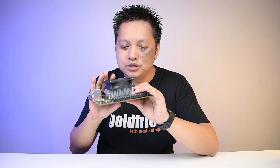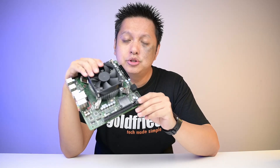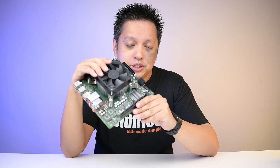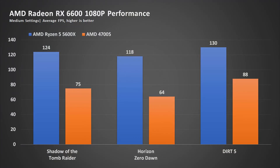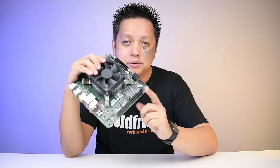However, there are still limitations. The PCIe slot is PCIe 2.0, and check out this benchmark using the AMD Radeon RX 6600 — a mid-to-low range graphics card. Even so, the performance is hampered severely, dropping to almost half, and that is mainly due to the PCIe 2.0 slot.